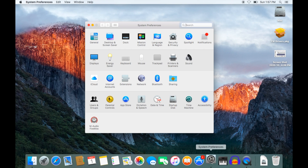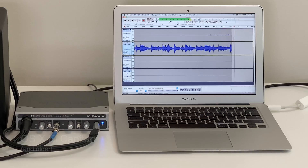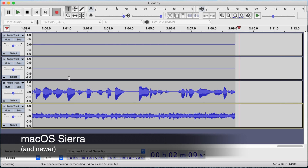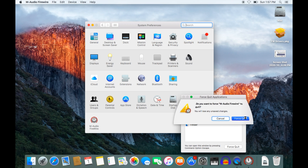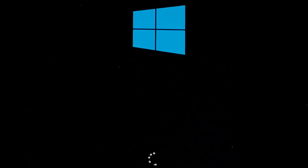On OS X El Capitan I was able to get it to work, but it comes with downsides like not being able to open the settings. On newer OSes like macOS Catalina, it's possible to record audio, but instead of using channels 1 and 2, it comes through channels 3 and 4, so you might have luck adjusting those settings within your audio recording application. In the end, I decided trying to make this fully work with a modern Mac just wasn't worth the effort, so unless you have an old Mac running an older OS, you might want to look into running your interface with Windows.